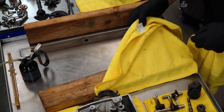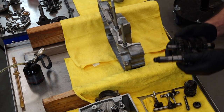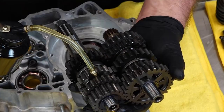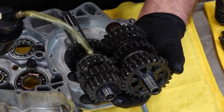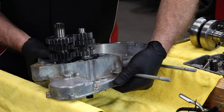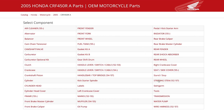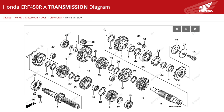We're going to tilt this up for a moment and bring in our transmission clusters next. Once we get it in there, we'll tilt it back on its back. There's still a fair amount of oil on both of these, but we'll add just a little bit more, especially where the shift forks engage and down on the shaft. Now, I kept all of my gears together, but if yours have fallen apart, please refer to the comprehensive diagram and make sure you've got everything in the right order. One shim or washer missing or out of place and this is not going to operate right.